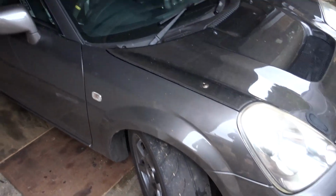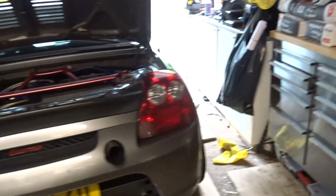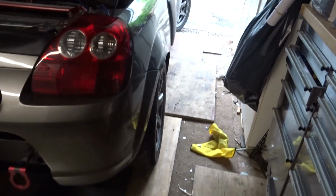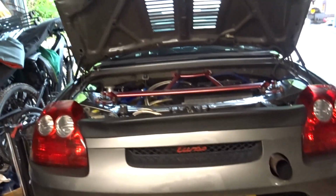I must have the car set up quite well suspension-wise, because both of them commented that in the corners, this was just much quicker. So, shout out to Crisp Tuning. That's probably down to their alignment. So we've got 3.5 degrees of camber on the front, 3 degrees of camber on the rear, 0.1 inch toe-in on the rear, 0 toe on the front.